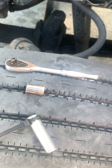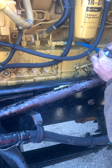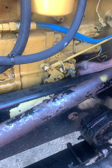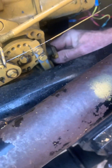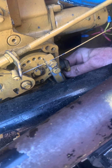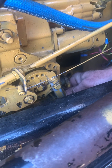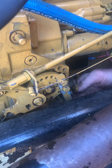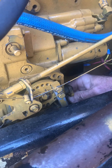Now we're gonna put the cover back on — that's two 7/16ths. We had it turned all the way out; actually we had the damn screws out of it. Before we got the new nozzles, she was smoking like a motherfucker, blowing black smoke all over the place. You'd follow her like a freight train. We did not know one of the nozzles wasn't even connected either, not until we got in there and replaced the nozzles.